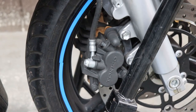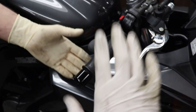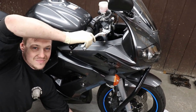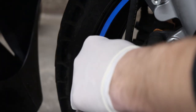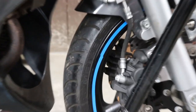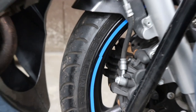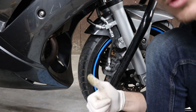Clean — ready to accept some brake pads. This is how you would reset those pads to be back up against the rotors, like in a car when you pump the pedal to get that feeling back and get that pressure back. I just can't get over it — it's so new to me. Similar to a car: he's gonna pump it, I'm gonna open it, fluid's gonna come out. We're gonna run the new fluid from the reservoir down through the bleeder and flush it out through the whole system, all through the brake lines, all the way up to the reservoir. When clean fluid starts to come out, we've done a good job.